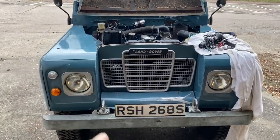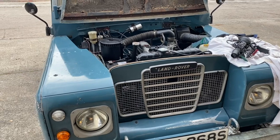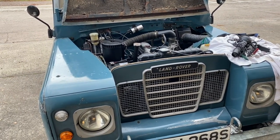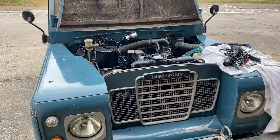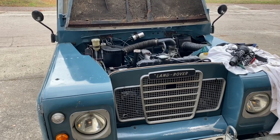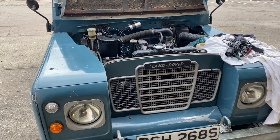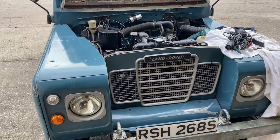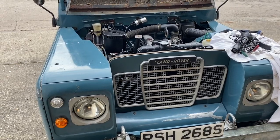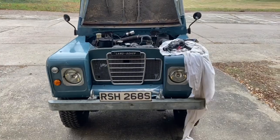And also, although that battery is still pretty low, I checked the volt drop on starting and it didn't drop below 9 volts. It just turned over the engine really slowly, and this morning it did exactly the same thing. So I'm probably just going to live with that, because as long as it starts the car, I don't really mind. And then when I'm feeling a bit richer, maybe after Christmas, not that I'm rich, but I will buy a new battery for it. But at the moment, that to me is absolutely fine. Really pleased with that.